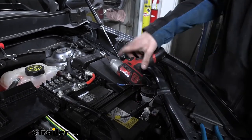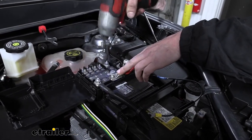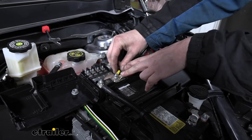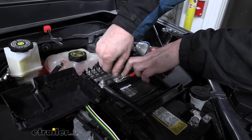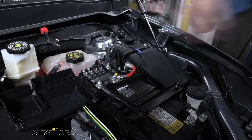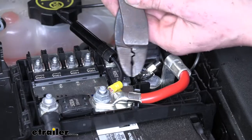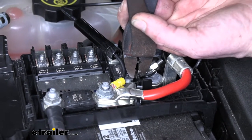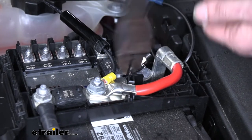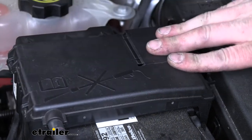We can then use our 13mm socket to remove the nut off the battery positive post. We're just going to take our wire, slide our ring terminal on, and then reinstall the nut. We can then make some small notches right here for our wire to pass through, using the wire cutters we were already using — just put a snip in there, grab the middle piece and work it back and forth, give it a little twist, and it'll break off. That'll let our wire pass through and allow the cover to close.